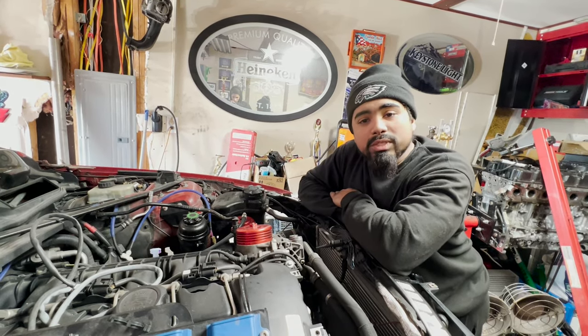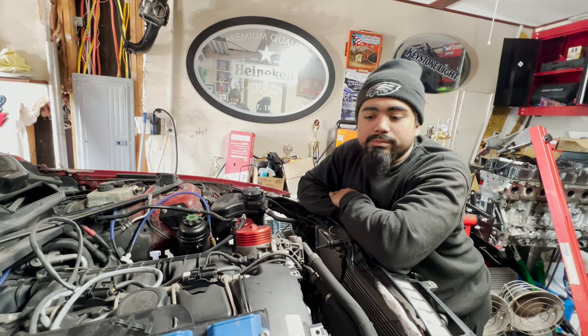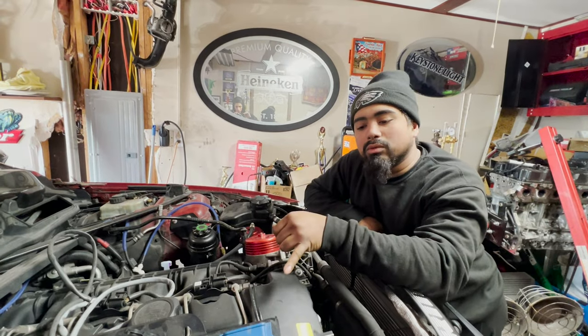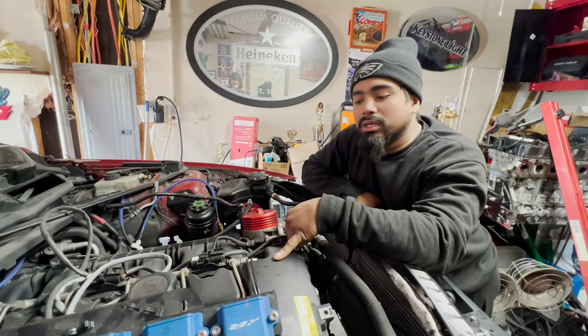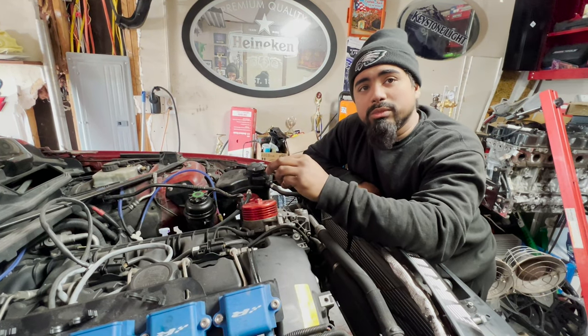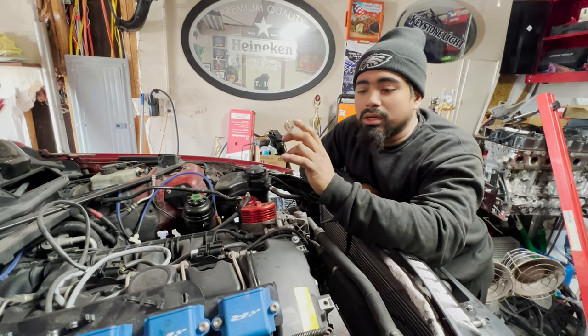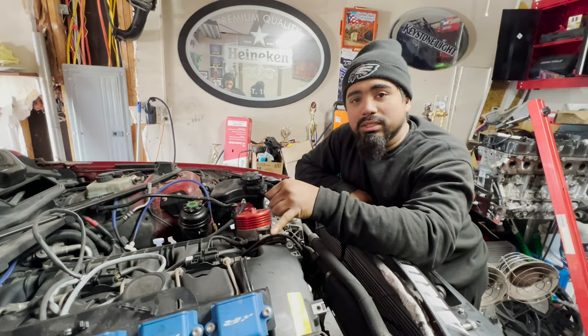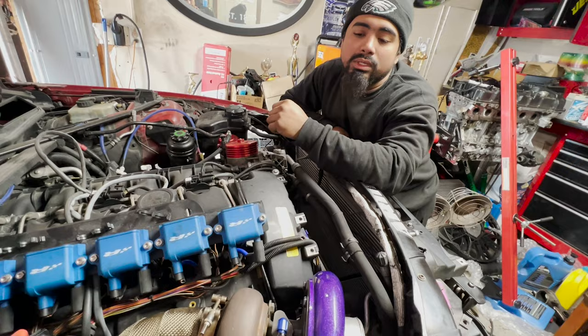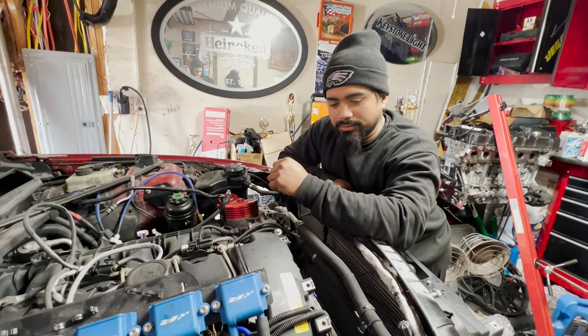Yes, you do have heat up top, but there's ways around that, you can do heat management. I only have a titanium wrap around the whole manifold itself. I also have it on the wastegate down tube and my downpipe. If we have any issues with heat, I'm thinking about maybe getting some contact about that as well. I'm thinking about sending my parts out to get ceramic coated and then titanium heat wrap around it as well to help with the heat management.